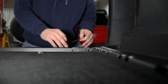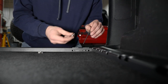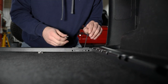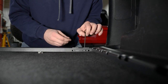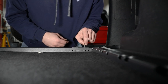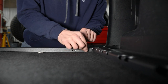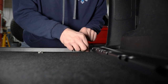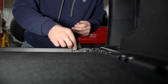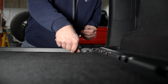Here at the rear of the frame, we're going to be bolting the frame itself to those nut strips we previously installed. Just because the nut strip is being pushed up by the carpet, push something through this top bolt hole — I'm using my Allen wrench — to let me manipulate the nut strip. Then line things up and install one of those quarter-20 bolts. Do that in each of these slots, then go do the same thing over on the other side.